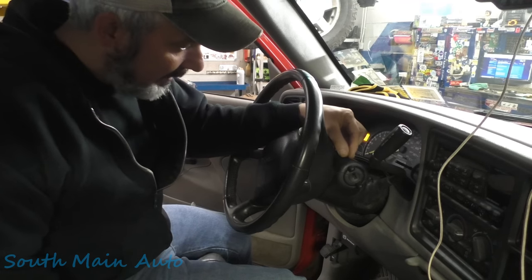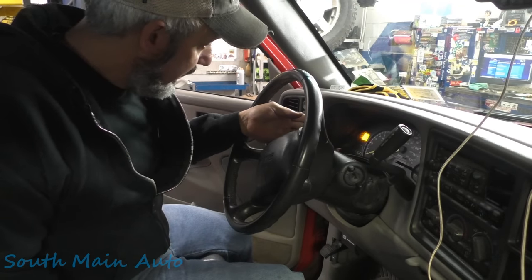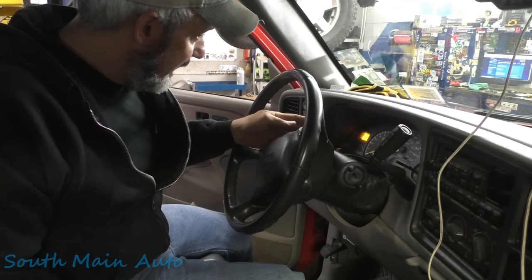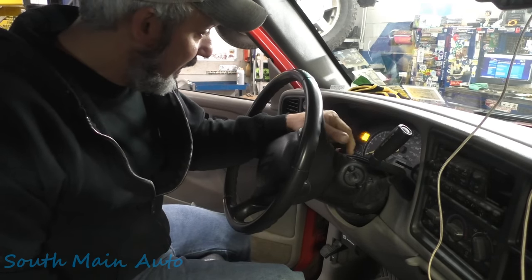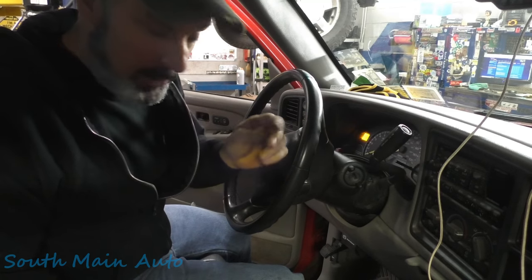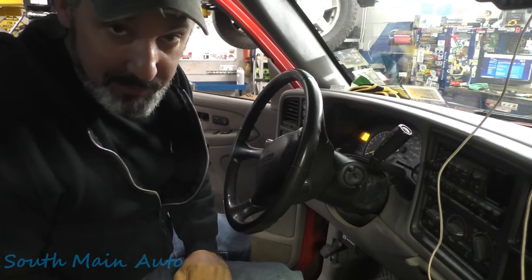You can elect to use just a fixed resistor and then relearn the security. I'm going to be a little lazy — we're going to see what the voltage value is coming out of the sensor while it's working, then I bought a variable resistor that we'll install and keep turning until we get the right voltage, so we don't have to do the relearn procedure.